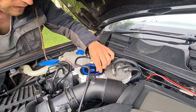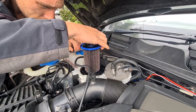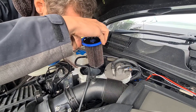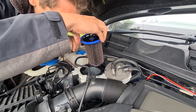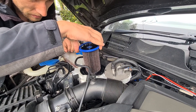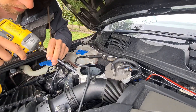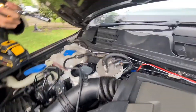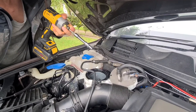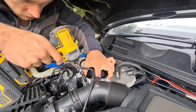I'm going to actually take the whole container out — actually I'll check it first, see how the container looks. So there is a bit of sediment in the bottom there, so I think I will drain the container out and clean it properly. So if you haven't already lost yours — which most people do — there's a 10 size bolt just down here, one on each side. Just take them off and this is just a container.